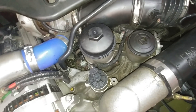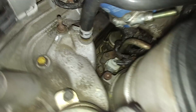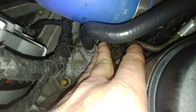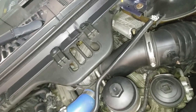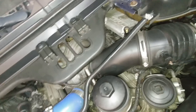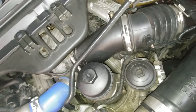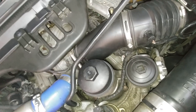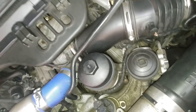Are they trying to pull a fast one? I don't know. Look at that freaking hose — see that hose clamp right there rubbing right into that wire? Rubbing right into the battery wire. That hose clamp goes facing this way, but the clamp's going that way. That's me being nitpicky. But we're going to plug this hole up and just hail Mary, caution to the wind, and see what it does. I can't believe that — it's just ridiculous. That makes me look at the rest of the truck and wonder what the heck they had their hands on, because are they trying to mask a head gasket issue and sell it? Or were they running waterless coolant? That is an option. But we'll see — I'm going to go ahead and plug that up.